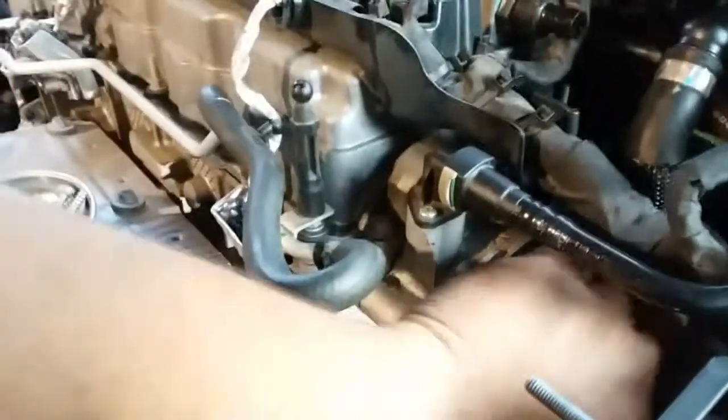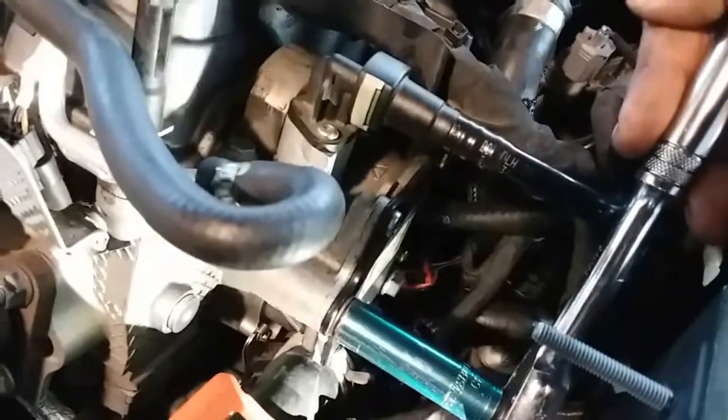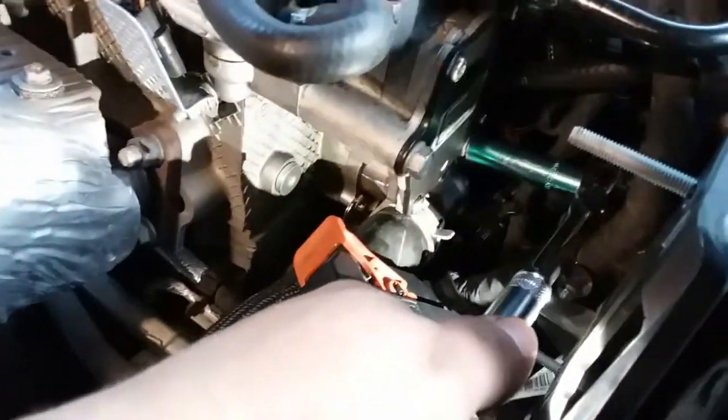So now I'm getting all these in here and all three. So I'll go ahead and tie those down, then we'll move to the throttle body and the intake housing, then the computer, and we should be done. Yay. All right, and we're gonna be using a size 13 socket to tie these down. You're probably gonna need both hands, and this one is actually better angled from down here. All right, there it is, nice and tight.